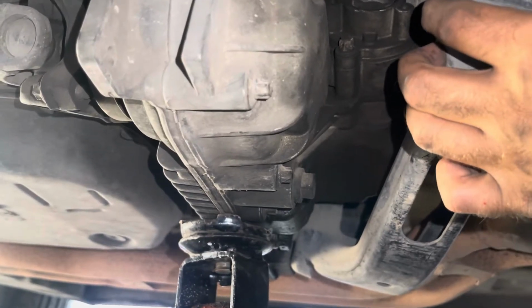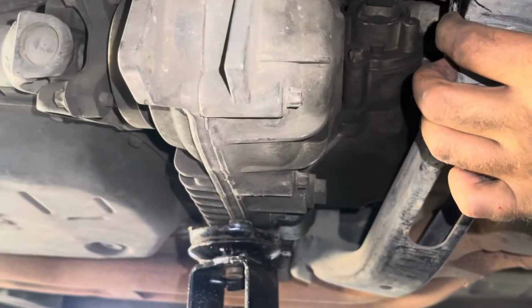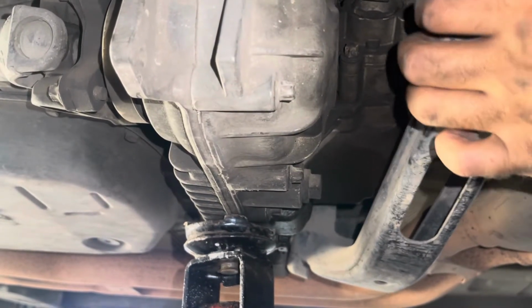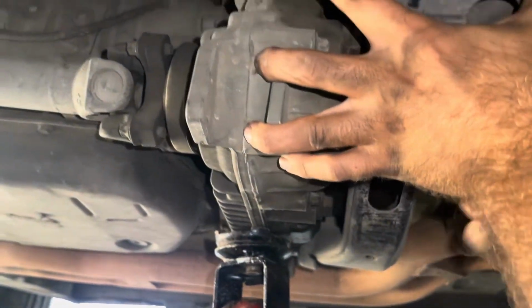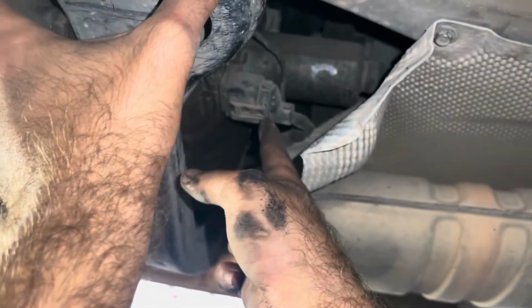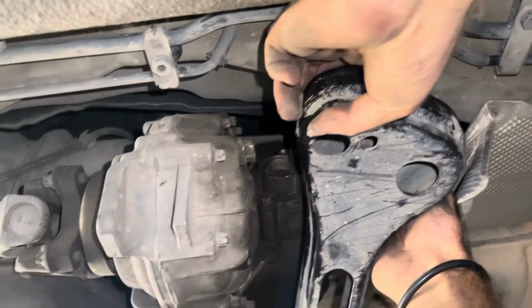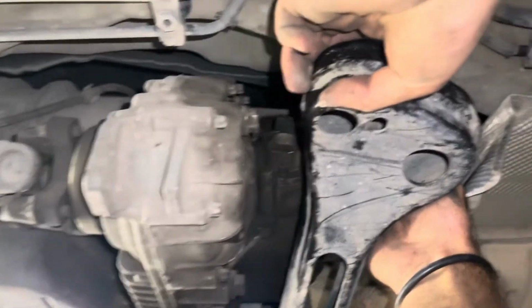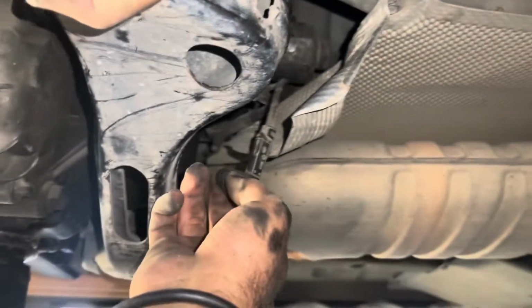This is the position sensor. As you can see, it has an E7 bolt. You gotta remove that also before removing the sensor. And then all we have to do is unplug the connector over here from the back side. This one, push this tab, pull it out, and then we can remove the whole motor out. Okay guys, so now that we got the E7 removed, we can pull the sensor out, set it to the side here, then onto the E10 bolts.